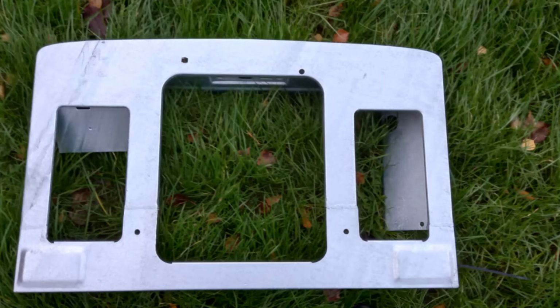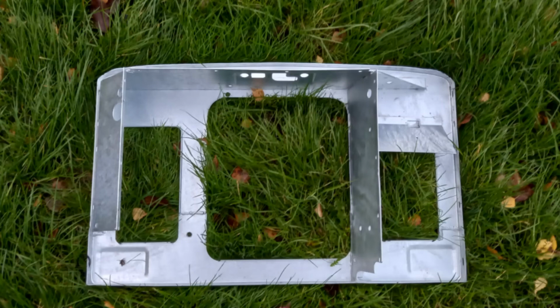And in the centre two pillars, you can actually still see a little bit of the weld. Now the reality is that was deliberate because you can't see that behind the grill anyway, and I wanted the extra strength. So if you do end up with a little bit anywhere, make sure it's on the centre two, because you really can't see them. There's a picture of the back also, and at that point we're ready to apply finish.